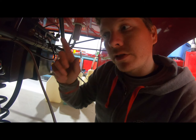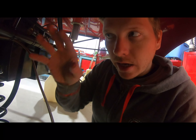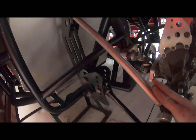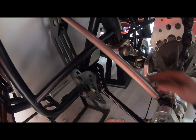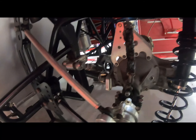One thing you want to make sure about is that your drive shaft is not too long. You want to let your rear end fall out and check to make sure it's not bottoming out into the transmission. If your drive shaft bottoms out at your drop numbers, all your drive is gone — because no longer is the car pushing up on the bars, it's now pushing into the transmission. You lose all those thrust angles, and that's no good. That's never going to work.